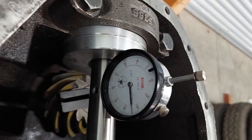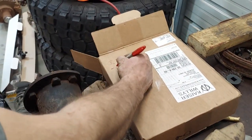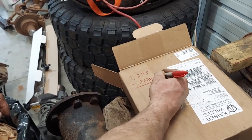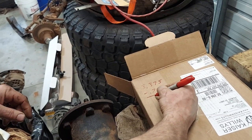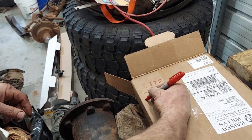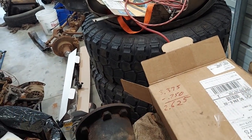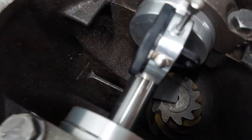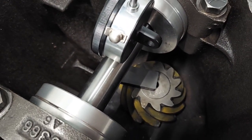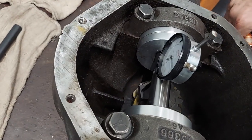Follow me over here to the paper — we're going to do some math. We have 3.375 and we're going to subtract 0.750, which gives us 2.625. We really need to add back a thousandth because we're slightly off, so we could call it 2.625. Now looking at the actual depth stamped on our pinion — that was 2.624. So we're within a thousandth using the factory shim. The target depth was 2.624 and we're measuring 2.625. That's how you use this tool to check your pinion depth.